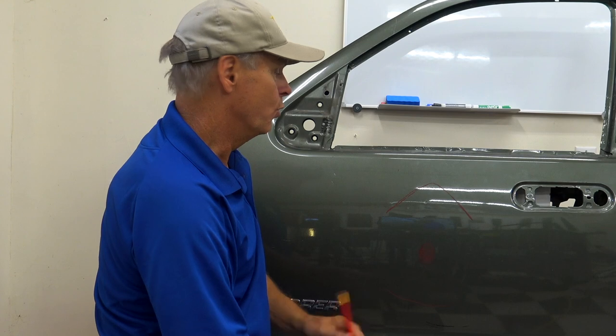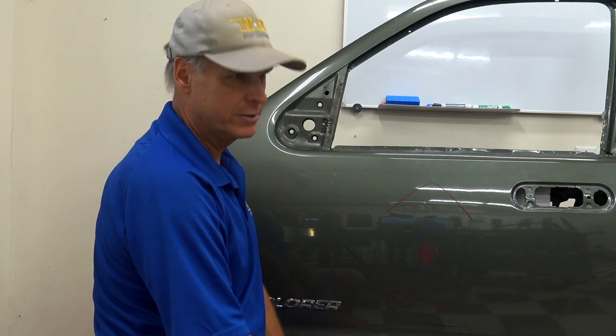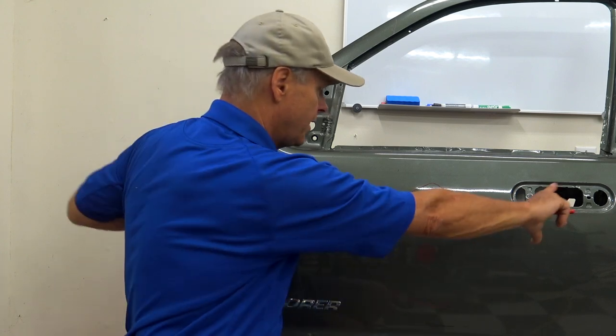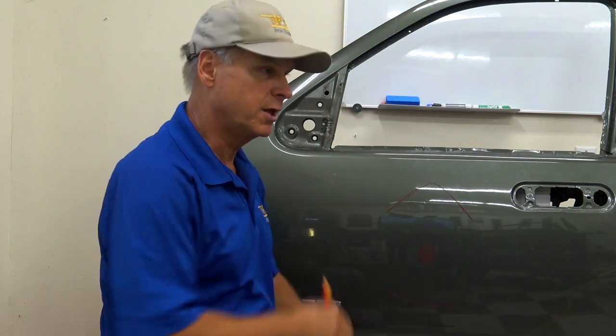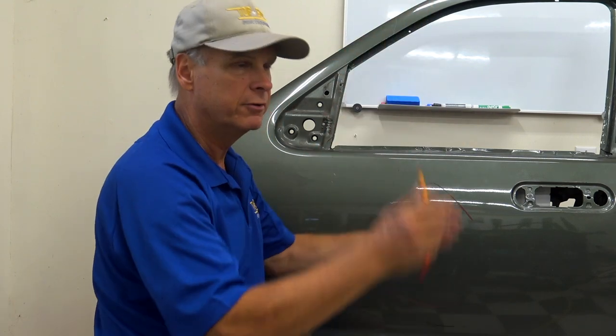Now, when we can do it, by far the fastest, most efficient way is with tension. No question about it whatsoever. You put tension on that panel, you can watch that crown go, dent pops out, keep the tension on it, get your pressure traps out, a few other things, bang, you're done, deliver the car, just that fast.